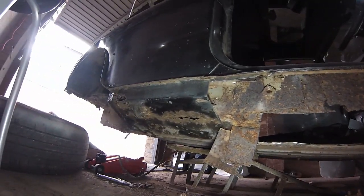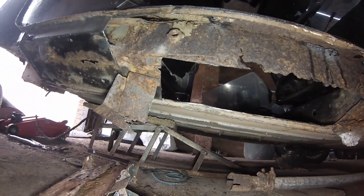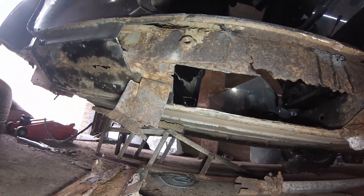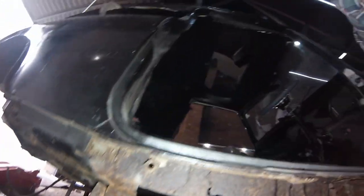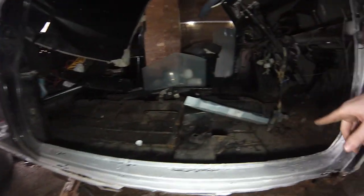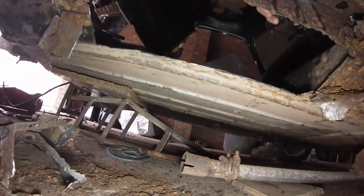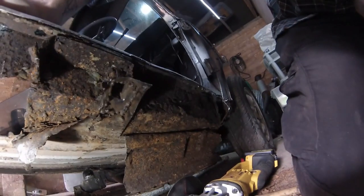I'm going to have to basically do that all the way to the back over there. I don't want to get too much off - I think I've already cut too much off probably, the car might just fold in a minute. But the roof is still intact, so as long as I leave this and the roof alone it should be okay to keep cutting - at least this piece. The rest of the floor isn't too bad, it's just this outer sill. The inner bit actually looks very solid - this part of the floor looks good to be fair. This whole outer bit that someone's bodged is horrendous.